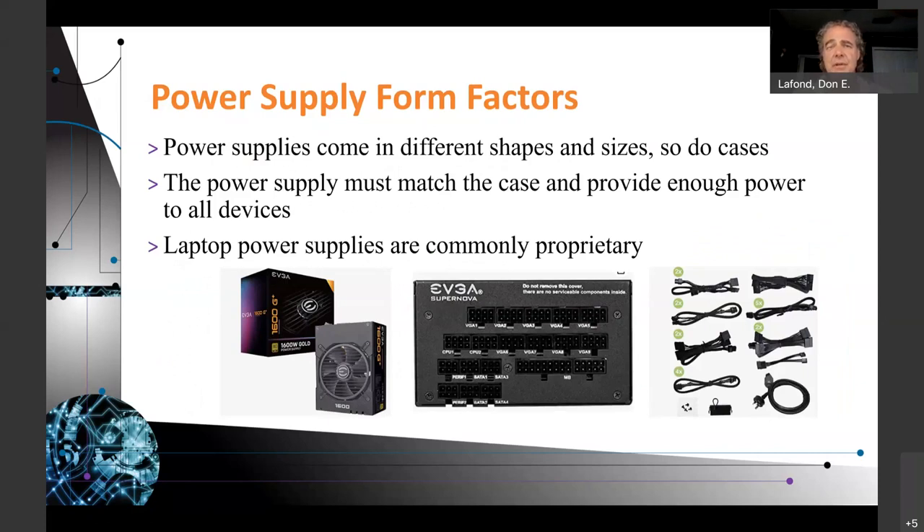For a general PC build, there are multiple different sizes of power supply, and you need to make sure your case fits the power supply you order. This is a power supply I actually ordered for one of my crypto mining rigs — it's actually 1,600 watts. I probably could have bought a cheaper one, but I put it into a personal computer and didn't want a server power supply. This is a modular power supply, where the power cords come separately from the actual power supply itself. I can connect a multitude of different devices and only connect the cables I actually need — one less cable sitting in my computer.